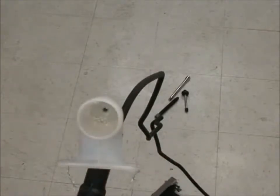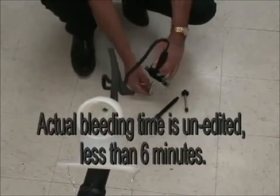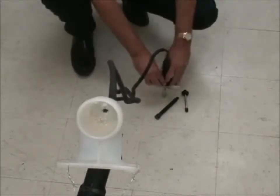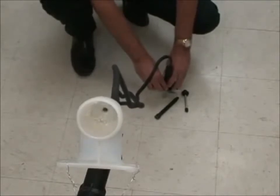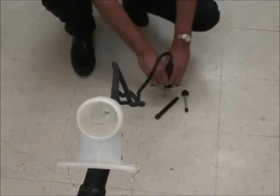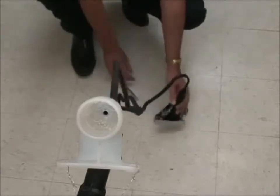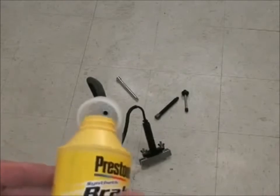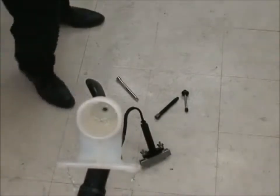It's already bubbling. Using the steering gear puller, I'm going to go through it — the screw is not in right now. I'm going to put the pushrod in there and push down on it. As I push down, it's pushing air bubbles out. When I relax and let the piston extend, it'll pull fluid back into place of the air bubbles, and the fluid level will go down in the reservoir. We're not venting any fluid out — we're getting rid of air. Time to put some more fluid in and continue compressing the piston.